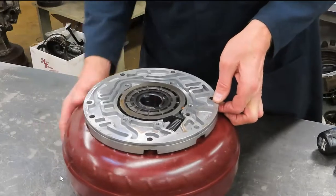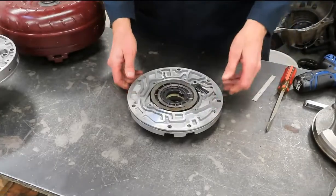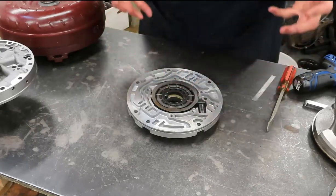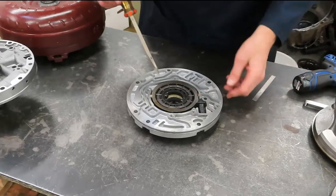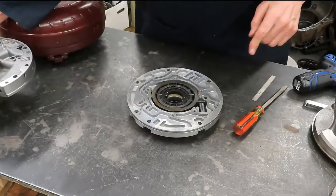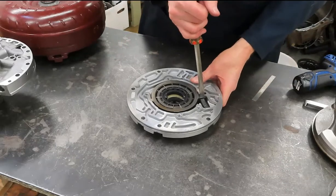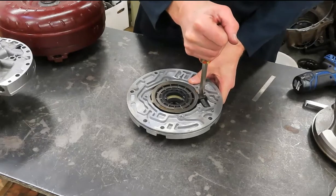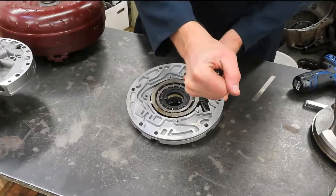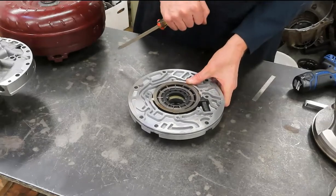The principle of rotation is no different, and even on these pumps they'll have you use a straight edge. This is a variable vane pump — the torque converter rotates these blades. When engine load is light, the pressure regulator — a valve inside the pump — operated by the electronic pressure control solenoid, will reduce pressure and volume by moving this slide ring. As the slide ring moves, this side and this side become more equal, like at cruise RPM or light loads. Under heavy loads like acceleration, it supplies high pressure to the clutches.